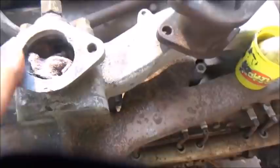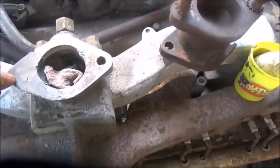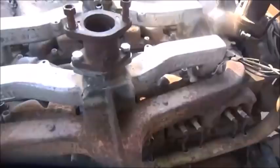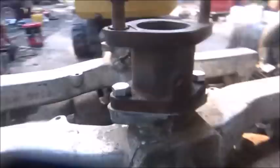Alright folks, we're getting there. It's hardened up pretty good. I can still feel it move a little tiny bit, but I think it's ready to drill and tap. I've got a helper here inspecting it for me, see how it's going. So we're not going to call this good as new, but we do have it on there. I don't have a gasket under it yet, but I want to check the gap. It's perfect — I've got it good and flat, bolted on really good.